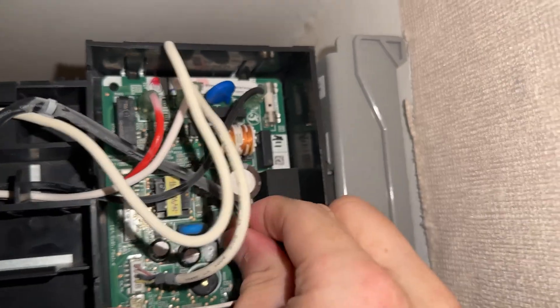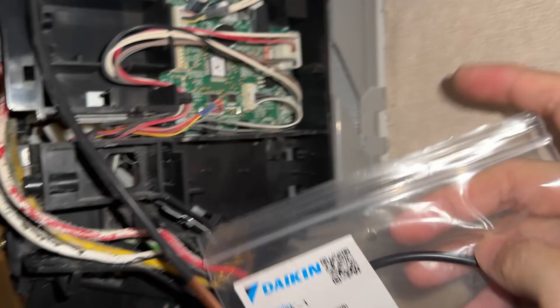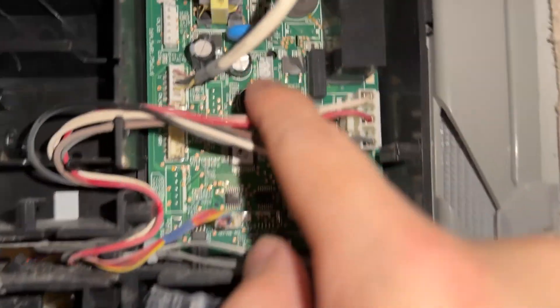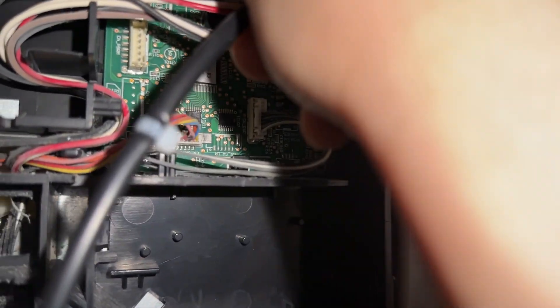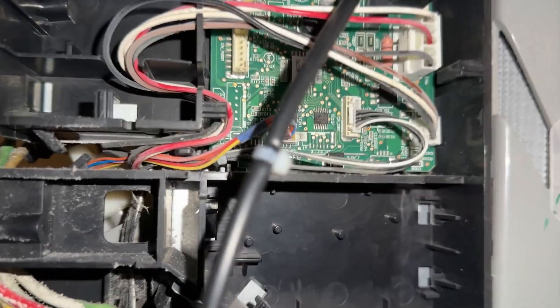So I just put this out — there you go — and I'm going to put in the new one. I'm going to replace this old thermistor, the temperature sensor, and replace it with this right over here. It should be pretty simple, it's just one-sided, it can never go wrong. So let's plug it in. And guys, by the way, make sure you turn off the aircon first before you do this.